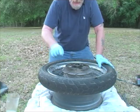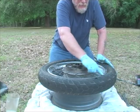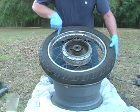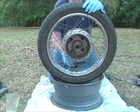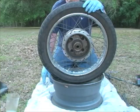Last thing, if you look very closely at the tire, you're going to see a little tread groove or a little bead groove, a marking. Follow it around, make sure it's equal all the way around, both sides, all the way around. Set the final pressure. Snug up the nut. And this just has to be snug, not tight. And you're done.